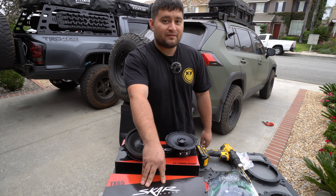Now the first thing I did was get my little bracket here. What you're going to do to make it work with these 6.5 inch speakers is take these little nubs off. When you're done, it should look like this. All I did was grab the bracket, grab any pair of pliers, and just yank on it — give it a little twist and they break off very easy. These are made with little cutouts that make it easy for the tabs to come off so that you can fit the appropriate size speakers. These brackets fit multiple sizes, so if you go with something smaller, look at the instructions on the packaging. I recommend 6.5 inch speakers because that's the size that's going to fit in there and sound real nice. These will be in the description box below.